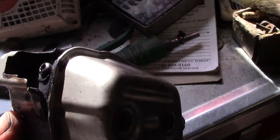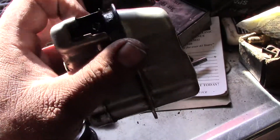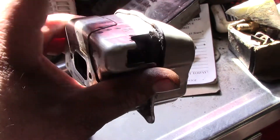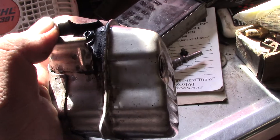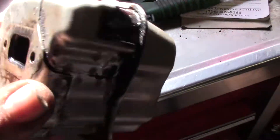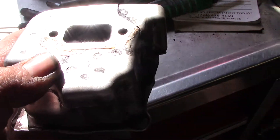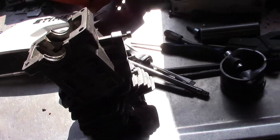I could have a muffler problem too. Look at that muffler — it's black. If I cut this apart, clean the stuff inside, and open this hole up a little more — maybe to nine-sixteenths in diameter — that might be a good number. I'll think about this one.